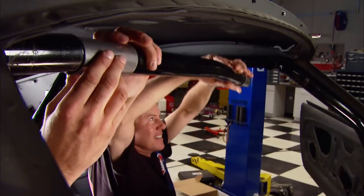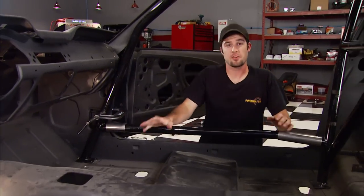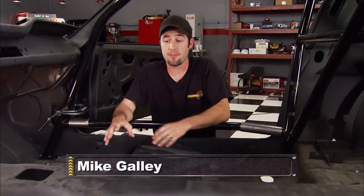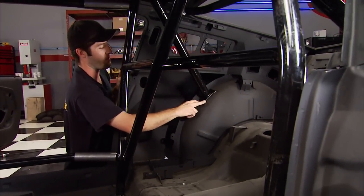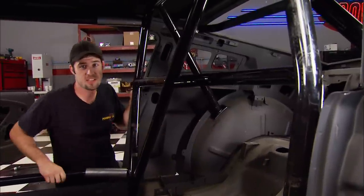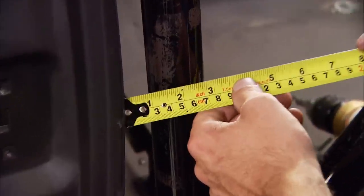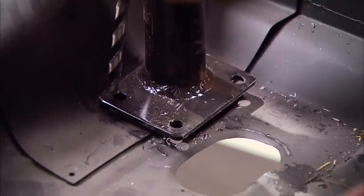Finally the windshield crossbar. I'm going to throw a tape on this thing, but I almost don't have to — every corner is almost perfect. Check out the rear support braces: they have a little curvature on the mounting pad which fits almost perfect to the wheel tub. For a pre-built cage, it doesn't get much better than this. Inch and seven-sixteenths — we're square.